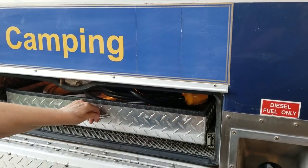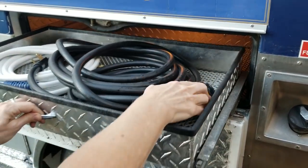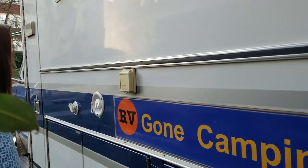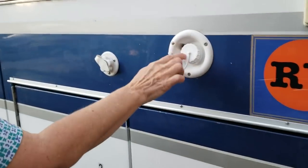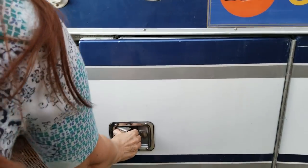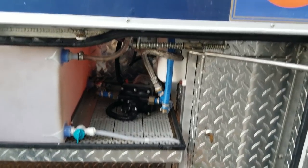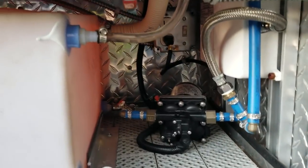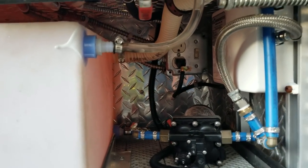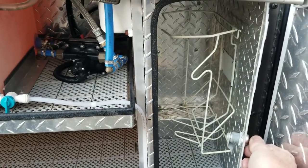This is the drawer unit we use for our water hose and our 30-amp plug. On the driver's side we've also got access for the 30-amp plug, the water tanks, and the city water connection. In the left compartment there's our water tank, our FlowJet pump — it's all PEX inside. We've got a 110-volt electric water heater; you flip that switch to turn it on, but you have to be plugged into 110 to operate it.